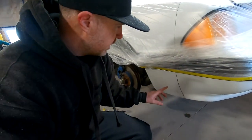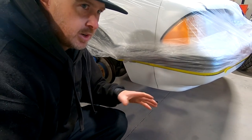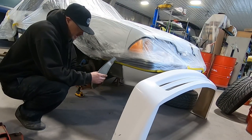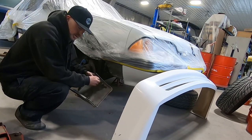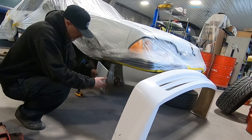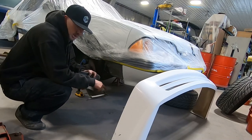The one thing with the front skirt — this fender extension here needs to come off. So we're going to have to get underneath the car and get this off, then get started on seeing what we need to do with the front bumper. I've pulled off the front fender extensions — there are a couple bolts here that hold these on. One of the studs was seized on, so that one snapped off. No big deal. You can see these two holes here, and then there's a plate on the inner side of the front bumper cover — you have to get three nuts off there.